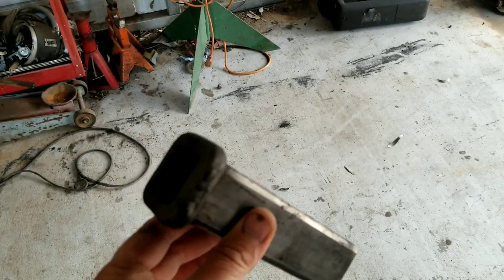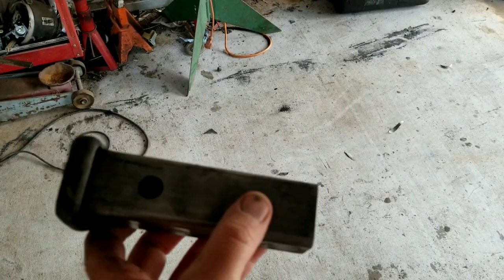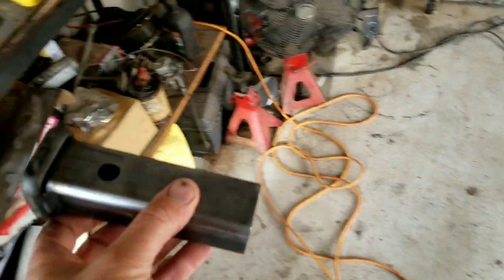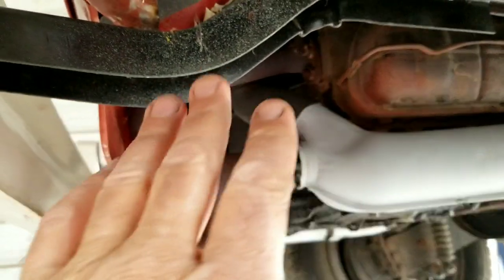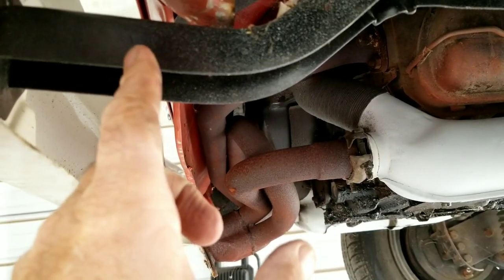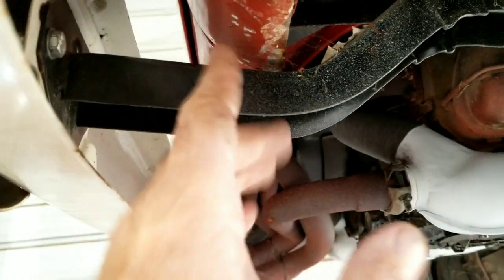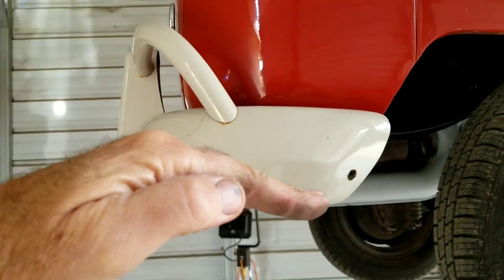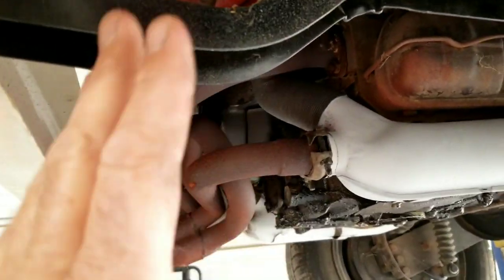You can also go to Harbor Freight - they sell a conversion one for about the same price, going from a type 3 to a type 1, and you could just cut off the piece you need. Those are made by Curt. There are a lot of different options with VW buses and not all the brackets are always going to have the same bend. These particular black brackets versus the Wolfsburg West ones are slightly bent up too far right here, which makes the bumper sit a little crooked. The black ones are about $15 and the Wolfsburg West ones are around $29 each.